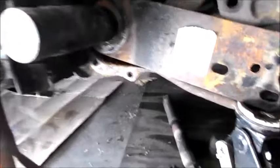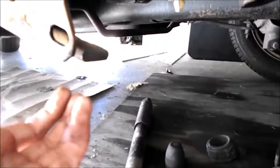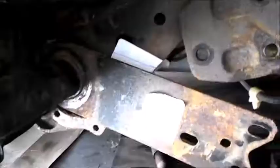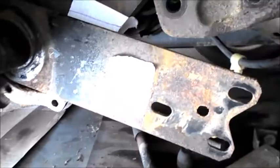Kind of at the midpoint here — I've got it off the stop position down in here, and past this point. One of the bushings is out of the way, the plate's out of the way. I've got the sway bar on here and there's just barely enough room to get your finger in there, but it still allows free movement so I can still test it. I'm using this pry tool — all I ever see is people using screwdrivers, but this thing is designed for prying stuff loose. I put a little piece of duct tape on this member and drew a line, so I've got a reference point showing how far I've got to take this plate — just easier to see, as long as I'm careful not to pull it loose.